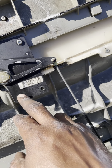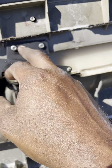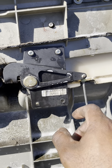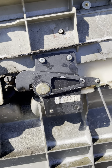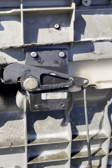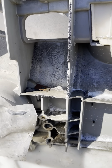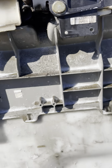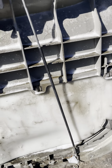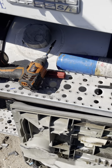So I took the two bolts out of here and I don't know why they weren't attached up here. It's supposed to be four bolts total. I had no bolts in the top and then these two were already broken. So I got it and I'm going to put it back in when I get done cleaning this door off and see if it'll open and close the door. But if any of y'all are having issues with a Century Class, as y'all can see, this is almost two decades worth of grit and grime inside of the door panel.